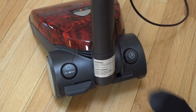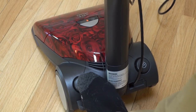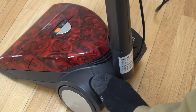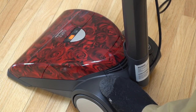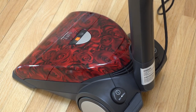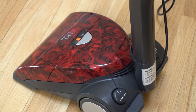Another quirk of the Miele Art are the foot pedals. Along with the obvious, we have our cord rewind and we have our pedal release. But the power switch is something of interest. So as you can see, the power switch is both an on and off and a speed control — very unusual. There's your on, speed control, and you're off if you just tap it. On and off, on and off. Now to put it in low, you simply hold it. That's extremely strange.